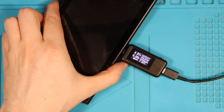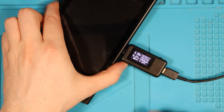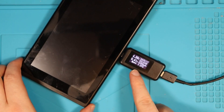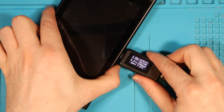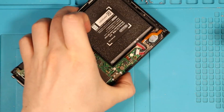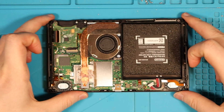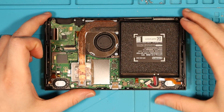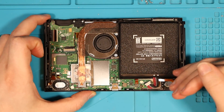I wonder — we flipped over the device, so does that mean the charging port has gone? Testing the other side: 0.01... does it bump up? Yes! So we're only getting a charge on one side of the device, which would indicate a bad charging port. Ladies and gentlemen, the time has come — I need to do another charging port replacement on a Nintendo Switch. I've not performed one of these successfully and I really hope today we can nail it.